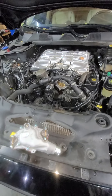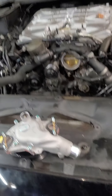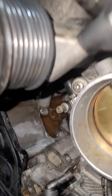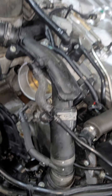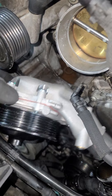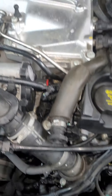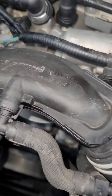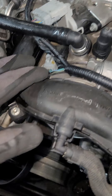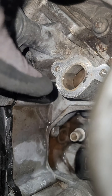Finally we found the problem. When you look at it, it seems like a water pump issue because the leak was coming from the bottom of the water pump — right in this spot back here. We saw some antifreeze on top, so first we thought it was coming from the top, like hoses or this housing right here, but it was not. So I had him accelerate, hit the gas, and when he did I saw a lot of antifreeze coming out from this spot right there where the water pump is.